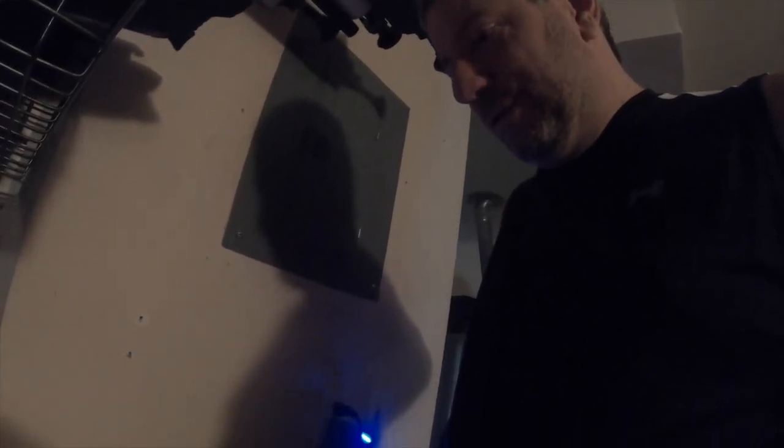Okay, so it's actually just a couple minutes later. It's almost 3 o'clock, so about 7 minutes later, and you can see we're at 83.7 volts and climbing on the 5 amp. I assume it's going to ramp down pretty quick and just start to trickle to balance the cells. But that's kind of amazing for people who are talking about charging all night long. Maybe think about upgrading your charger to put some real amps onto it.